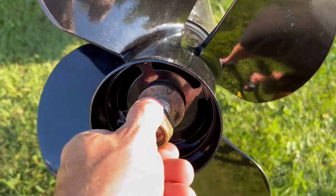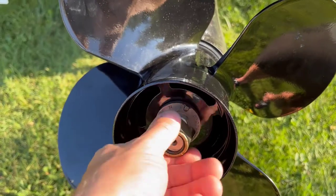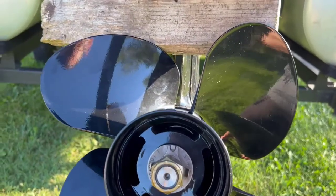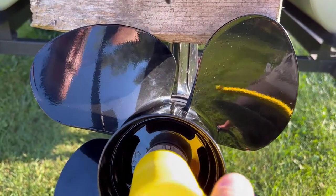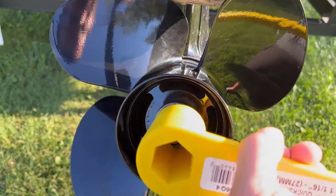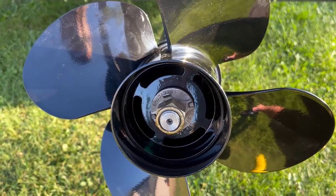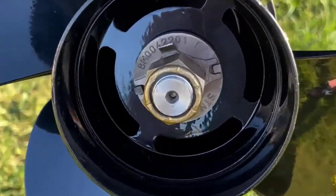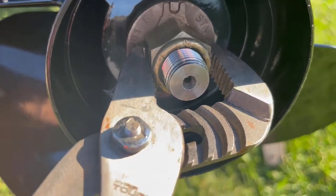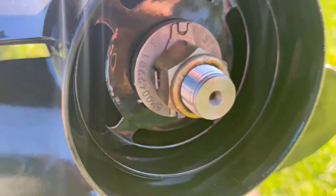Follow the same steps as before — put the 2x4 back in place, get it jammed up nice and snug. Engine in neutral, and they suggest removing the spark plugs and making sure the key is out. Snug that up, then put those locking tabs up. I've got my 2x4 wedged in there and I'm snugging this up — note I am not using an impact, I'm not taking a shortcut, just taking my time. It doesn't go on super tight. I believe this one was 55 foot-pounds, but if you're doing this on the lake and you don't have a torque wrench, make it snug — don't over-tighten it and certainly don't under-tighten it. To get the locking tabs back in place, use a pair of channel locks and squeeze those locking tabs up nice and snug. You can see now that our nut cannot come undone.